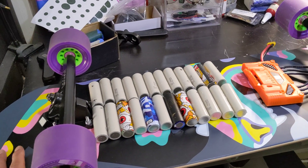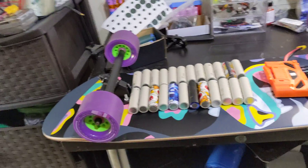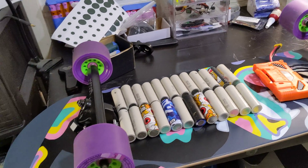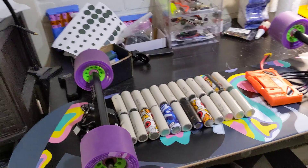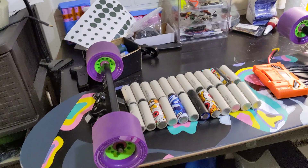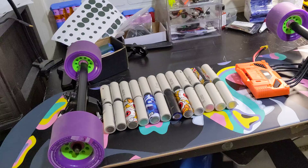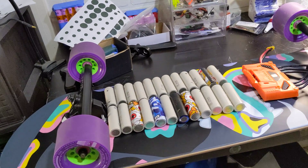I wanted to build a very light board because I could put a whopping 12s4p and get a nice 30-mile range, but that just makes the whole board super big. I'm trying to get something that's comfortable to ride, big enough where I can go pretty fast, and also with the rubber wheels get decent range. This 12s2p should give me a 20 to 25 mile range.